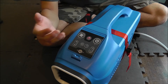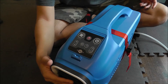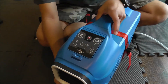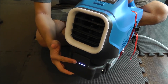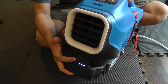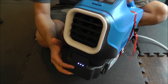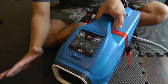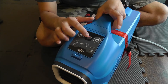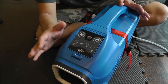As a result, the system will make a lot of noise, the condenser fan will come on but you won't get any cold air out the front. So here's how you do it. First step — in case of using a battery, you press and hold the button. You press the button once, then press and hold, and you'll get the three lights to come on. You need to hear the fan come on as well to know that the battery is on. Just know that once you have power, you'll see that red power light come on. This is how you get into standby mode.